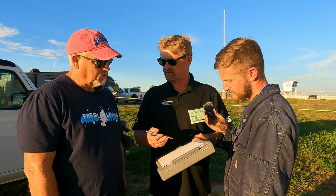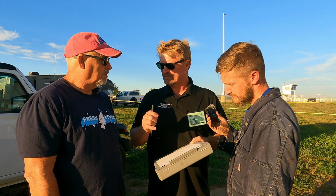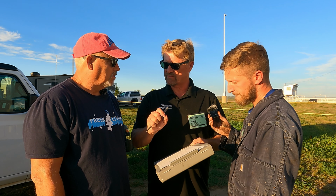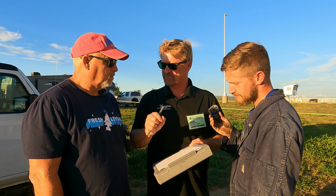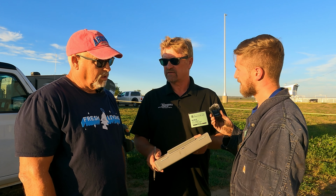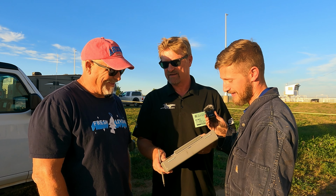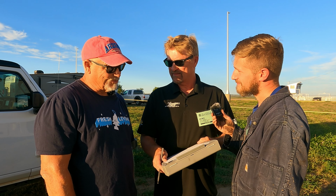module in the front for your steering gear, and those are adjustable. So sometimes you can fine tune if you ever get to where you're getting too much play, those things are available to fine tune down. You can actually turn the knob. They're very, very sensitive though. So about an 1/8 of a turn would be way too much. So you want to be really careful on that. I think I'd have a guy who knows what he's doing do it.